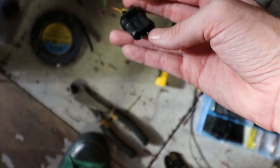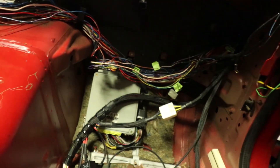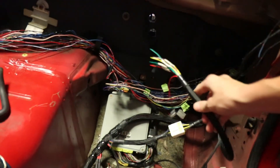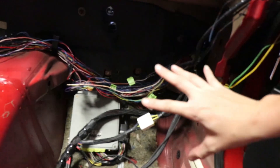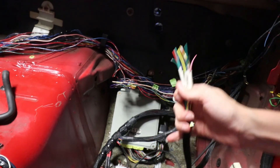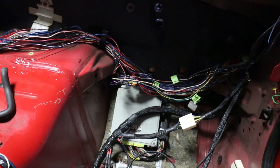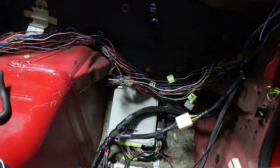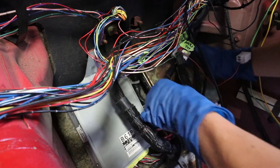From there we're going to run all three of these wires over to the ECU flying leads, which come out over here. These are all the leads here, and I'm going to put them in this well somewhere — I just haven't quite figured out exactly how I'm setting this up, so I'm going to leave myself a little bit of slack. I just have to figure out where those cables come down and then run the proper wires from that connector. The ECU for the SR-20 fits right next to the Miata one perfectly.